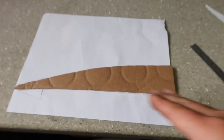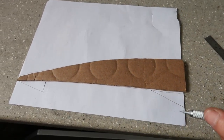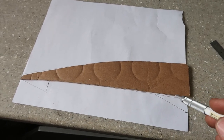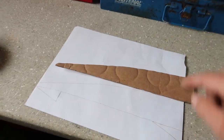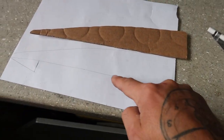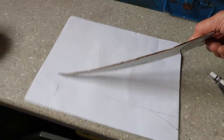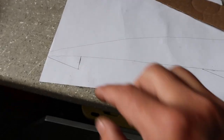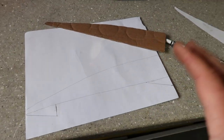to see if that's gonna be enough meat to help hold this bracket on, as well as aesthetically if it looks good, because I might need to extend these a little bit longer just to make them visually look a little bit better. But the thing is, you gotta remember these are gonna be bent like this. So if you carry these lines over too far, you won't be able to bend your part and bend this tab 90. So as long as your part is bent like this, you see how I have about 2 inches up at the top and the bottom of flat space. So that should work out pretty good, but I'm just gonna mock it up with paper just to make sure it looks good and it works.